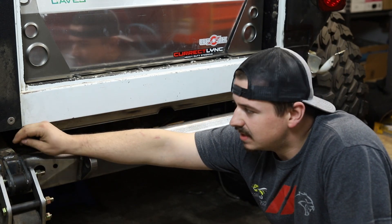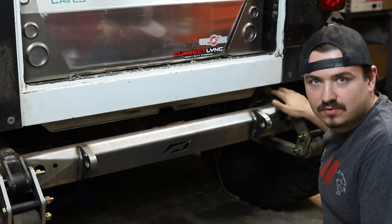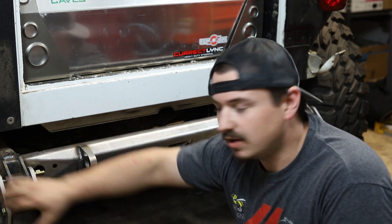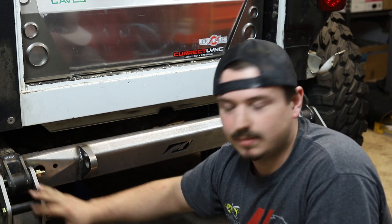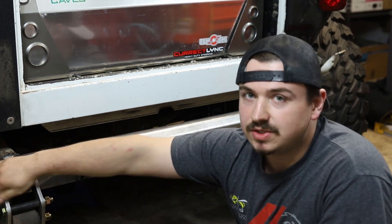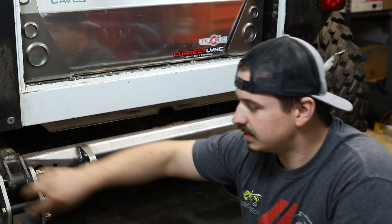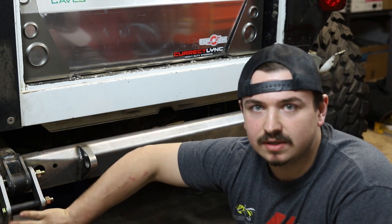I did take my time a bit to reduce the chances of warping. I did a couple of lines over here and a couple of lines over here, then flipped back and forth, and I didn't have any issues with that. Once you have everything finish welded on the bumper, you can go ahead and assemble your leaf spring hangers — there are three bolts on the hangers. The long side goes upright. When you get this kit, you're probably going to wonder whether to use the short side or the long side of the hanger on top where the poly bushing goes. The answer is you want to use the long side, in a V shape pointing towards the front of the vehicle. You can see the steel tube insert — put a bolt into there and loosely tighten it, then insert the rest of the bolts and add your leaf spring to the end.